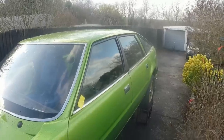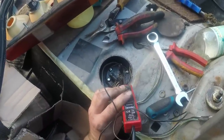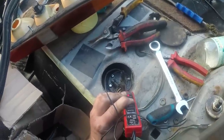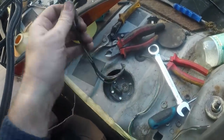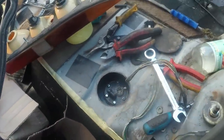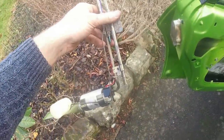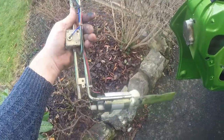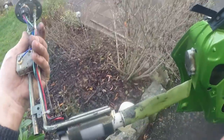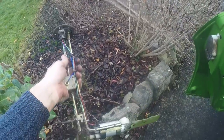I think it might be a weak pump — just too weedy for the job. Now jumping direct off the pump while watching the line at the same time: pump running, I can hear it, but nothing coming out. The pump is going to have to come out, which is a bit of an ask now that the tank's in the car. That'd be why it's not working — the elbow on the pump had fractured, and the last bit of it fell off just as I was lifting the pump out of the tank.